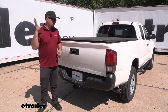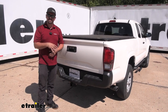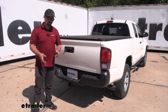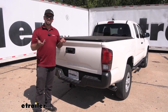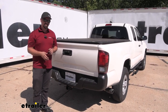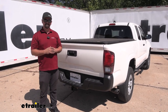With those capacities, I really like the hitch as an option for the Tacoma. Something that I also like is going to be the matte black powder coat finish — it's a little less out there as far as a gloss coating, a little more subtle, and I think it looks better. It also holds up to scratches and chips a little bit better than your normal gloss coating. Now as far as installation goes, this one in theory isn't that hard. You're just going to be running bolts through the bumper beam and then using factory weld nuts to tie bolts into the frame of the vehicle. But the bumper beam is pretty narrow, so it's hard to fish-wire that through and there are a little bit of clearance issues, but you should be able to knock this out in about an hour or so. You could definitely do this in your driveway or garage, so follow along and I'm going to walk you through the steps.